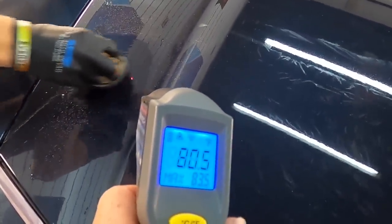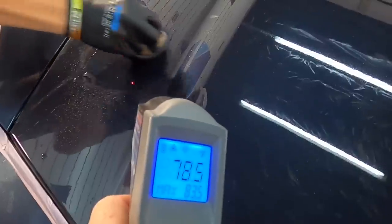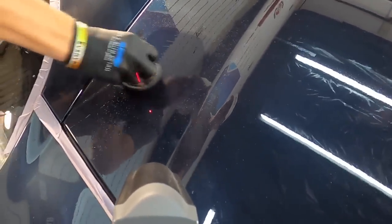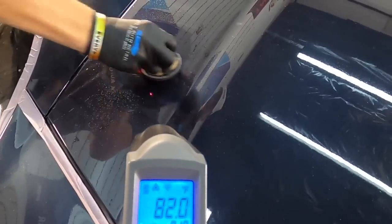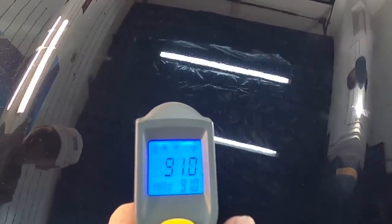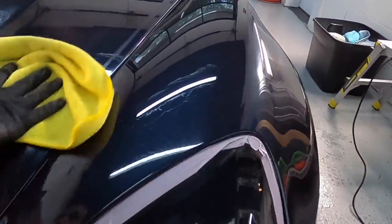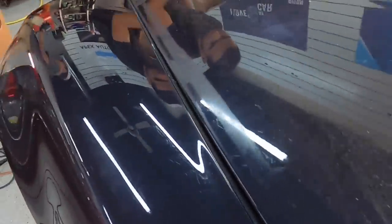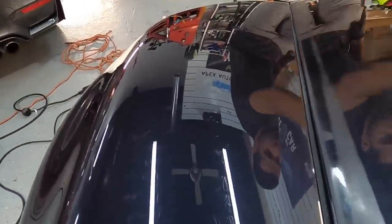What I'm showing you here is very important — this is the fluctuation in temperature when comparing machine polishing to wet sanding. You can correct safely and quickly with wet sanding compared to using a dual-action polisher going repeatedly back and forth. If you're not comfortable with wet sanding, I want to show you that temperatures are going to spike greatly with machine polishing. At this point, we have pretty much the whole fender corrected and brought back to life. Now I can concentrate on the hood — it's strange, the oxidation is only in small, skinny patterns but very concentrated within those patterns.